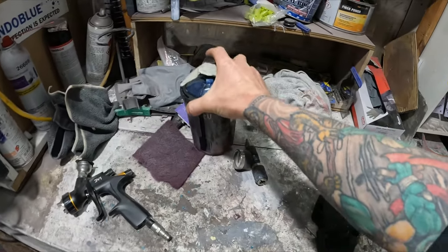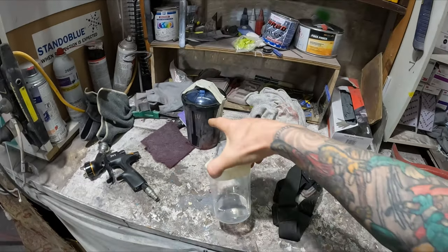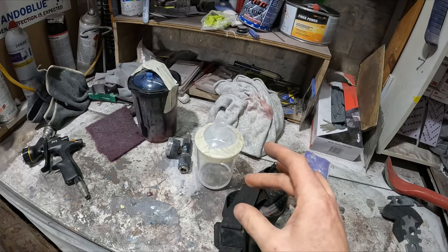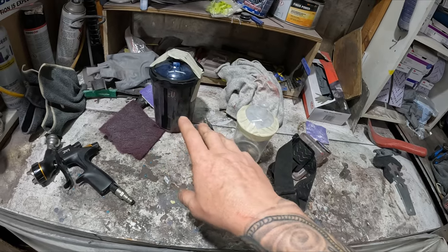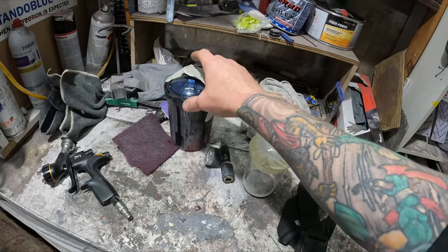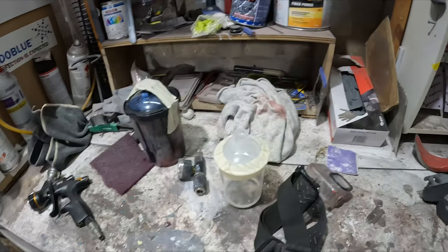As always, I did ask my boss to make sure it's okay to take that paint and he said that's fine. I also grabbed a little bit of activator here, because with waterborne paint it's best to put a little bit of activator in it just to give you a bit of durability. Usually at work we'll put some 2K clear over the base coat to protect it, but if you're just leaving it as bare base coat it is highly recommended that you put a little bit of activator in it.